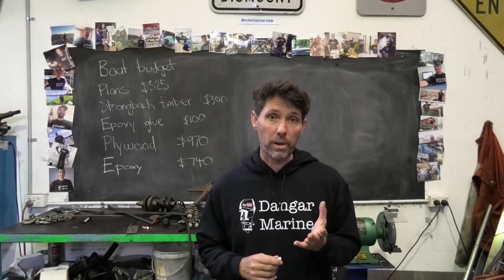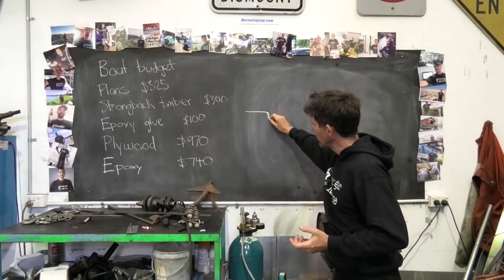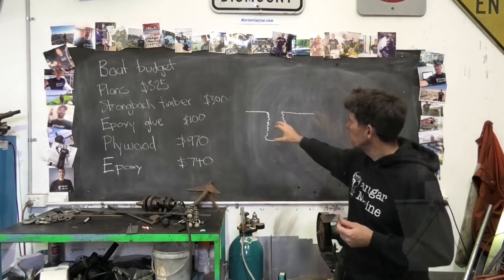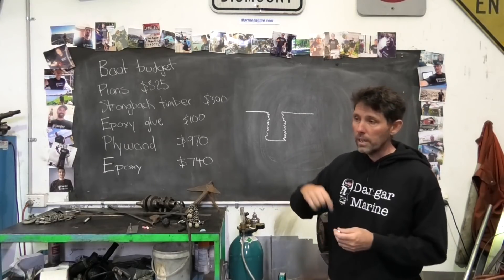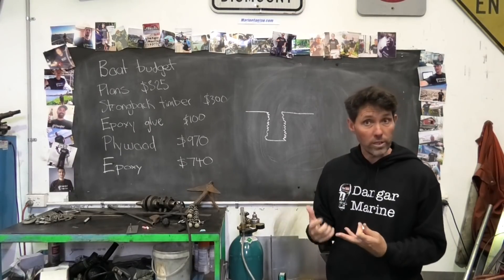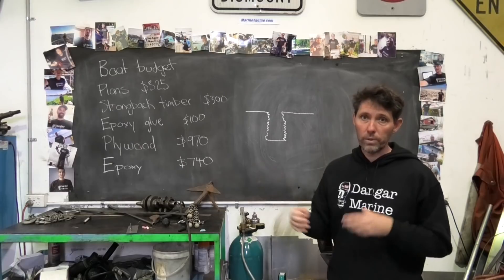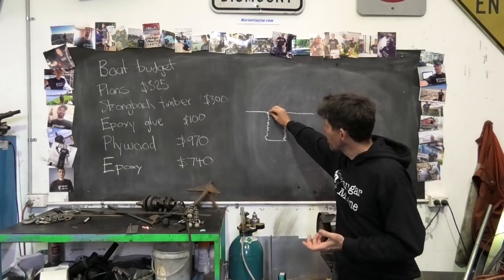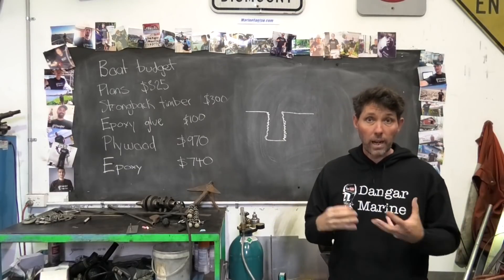There are a couple of ways you can go to repair a thread depending on the situation. If you imagine this is an engine block and there's a bolt in here with a certain torque spec — say 70 Newton meters — and as you're turning it the bolt just keeps spinning and never gets any tighter, that's because the thread is stripped out. This happens a lot where you've got a steel bolt going into aluminium, particularly if that aluminium has been quite hot at some point. What it means is that all the fine grooves have just broken away from the casting of the block.